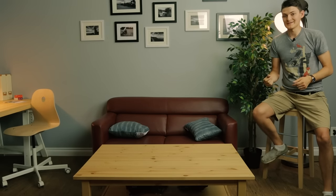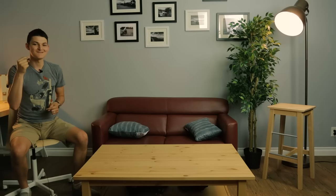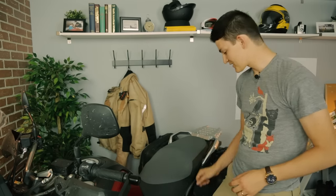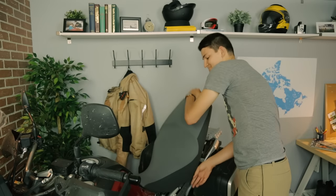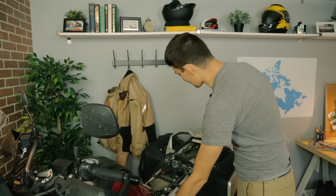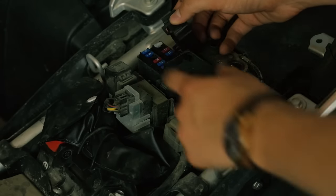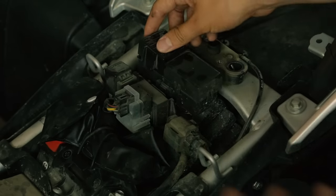Say I need to park my bike in the lot behind an apartment building — that's precisely where motorcycle thieves go shopping. So let's hack my motorcycle to make it impossible to start. On my old bike it was easy to yank the wire off the spark plug, but with this V-Strom, not so much. So we're going to go under the seat to the fuse box. I can see which one the ignition fuse is, yank that out and the bike isn't going anywhere.